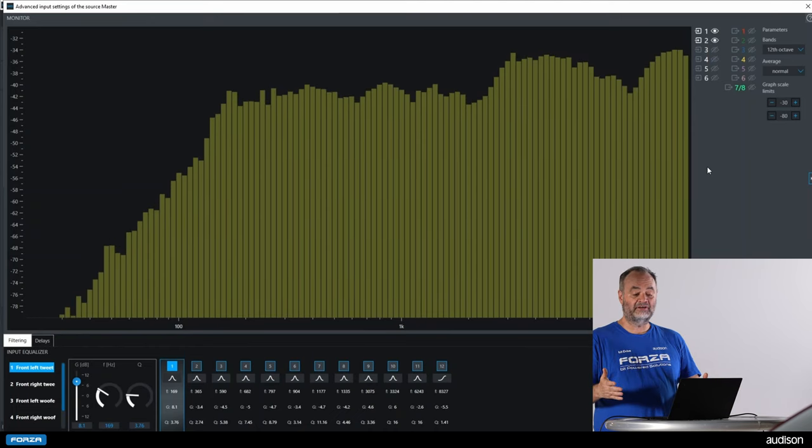I'll go to the equalization for channel 4, color coded yellow, confirming we have the correct equalizer selected. There's a dip at around 100 Hz — I already have a slider there, so let's add some energy at 100 Hz, and it does help bring up our output. There's also a problem between 250 and 400 Hz, so I'll select 250, shift it slightly, narrow the bandwidth, and add a little boost — that helps. The biggest problem is at around 2500 Hz, so I'll use a broad bandwidth and reduce that, making our response a whole lot more linear. I'll also move the 1000 Hz EQ to 825 Hz and bring that up a little. The response is now better, though not perfect.